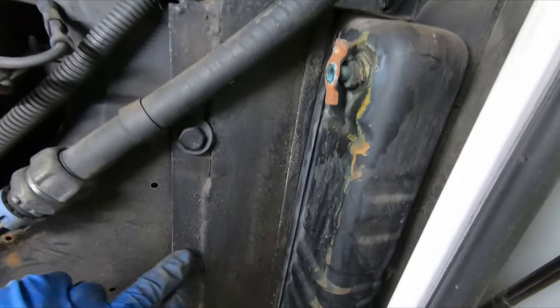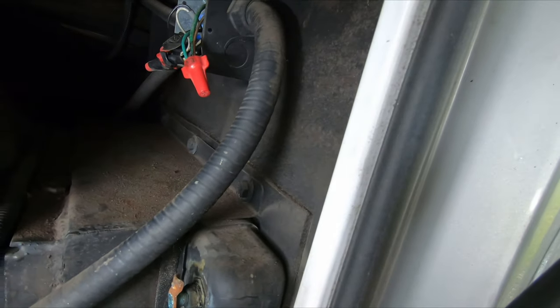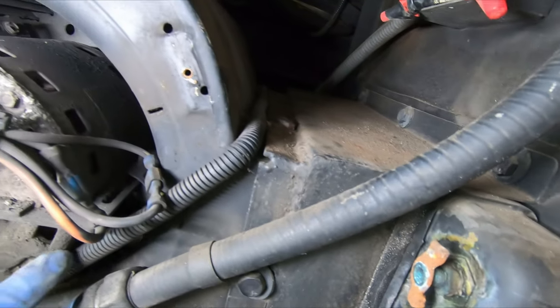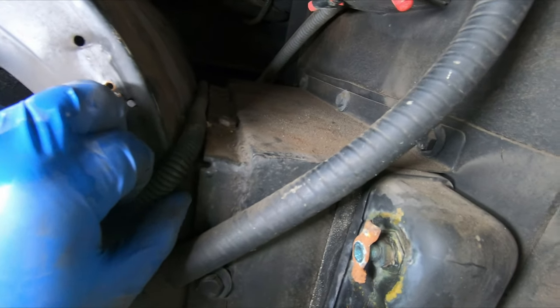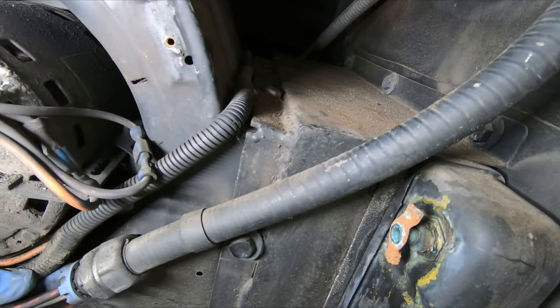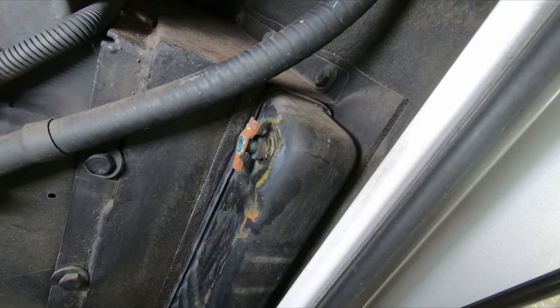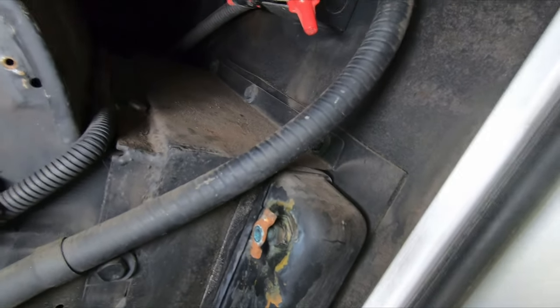So I'm looking at this farther, and I see now, in addition to these bolts, there's these three bolts on the top and bottom holding against the wall. And I'm thinking that is how Foretravel intends you to get it out. The reason I say this is because these are the wires that go to the capacitor. It's on the other side, and I can't tell what kind of screw is holding it in, and I don't want to just rip the wires off and then not know for sure if it matters which polarity they have, like an air conditioner. Some of these capacitors are polarized. So I'm thinking this whole assembly has to come out with these three top bolts and three bottom bolts, and the radiator will fall and kind of sit. And it'd be good to get this radiator replaced because it's leaked a little bit for a while too. So the first step is to open this box and disconnect all these wires and then unbolt these and see where we get.